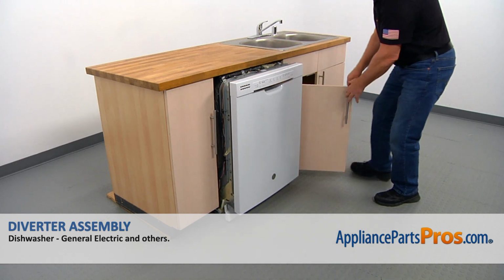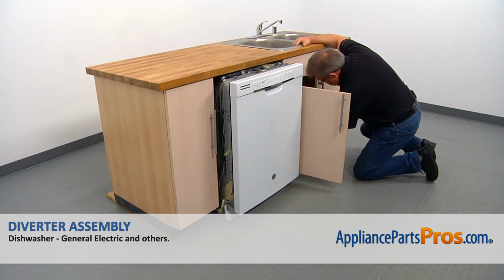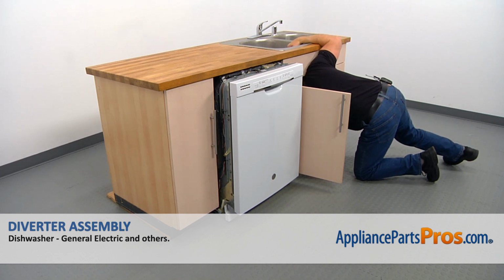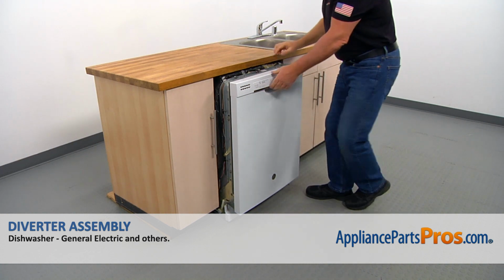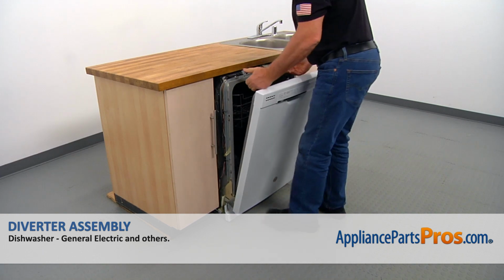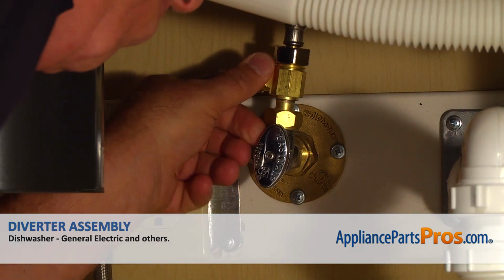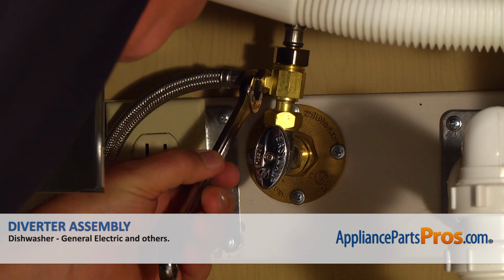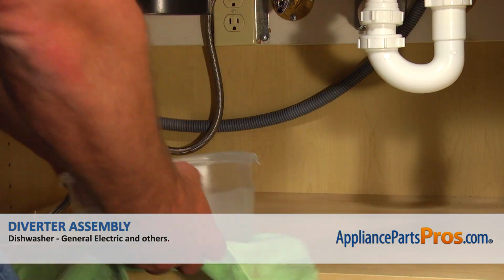Now we're going to duck under the counter and pull out the drain line, water supply line, and the power cord. And we can continue installing the dishwasher. Let's manually thread on the water line onto the shutoff valve, then tighten using the 5/8 open-ended wrench. And then we can take out the towel and the container.